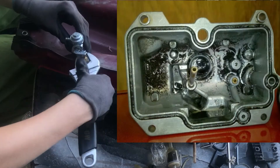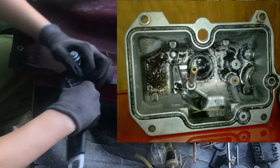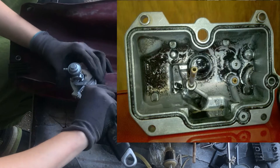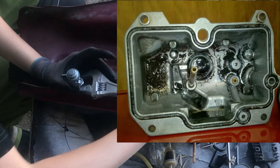It's always a good idea to shut off the valve when not using a bike, because otherwise the gasoline will evaporate in the carbs and leave a residue that will clog them up. It's also a good idea to have a few spare filters, especially when you have a steel tank.